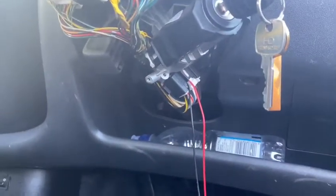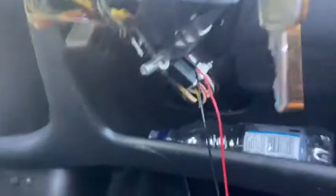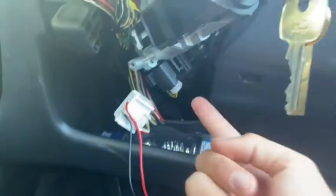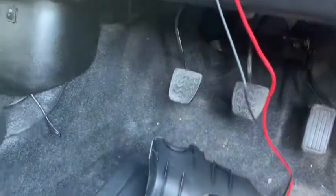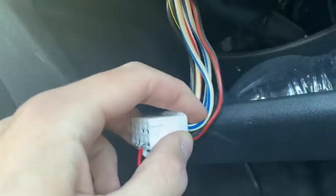We've only gone and done it — this was easier than I thought. I looked at a video and figured out which one's the starter wire. Let's unplug the clip. The red wire goes to the red one, and the black wire goes to the black wire, clipped in here — it only goes live when you press the button. For the blue wires, you wire those up to the starter wires. Mine are the yellow-and-blue and white-and-blue — two white-and-blue wires are the starter ones.